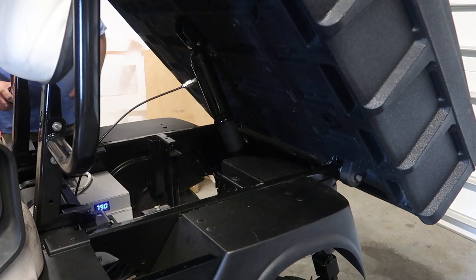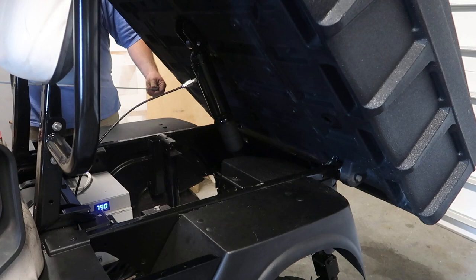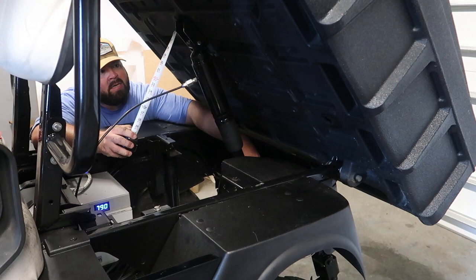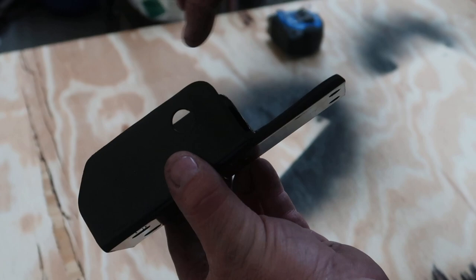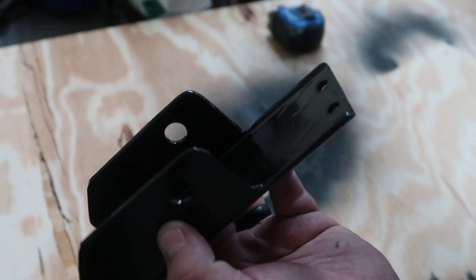I'm going to take this measurement between the upper pivot and the lower pivot — this will help us determine the cable length we need for the limiting strap. EasyGo Cushman sells a limiting strap, but I think I'm just going to make one. From center to center is around 23 inches. I got the piece painted, rounded some of those edges off so it's not sharp. I gave it a coat of paint — I think it looks pretty good. I'm just going to go ahead and stick it back on.